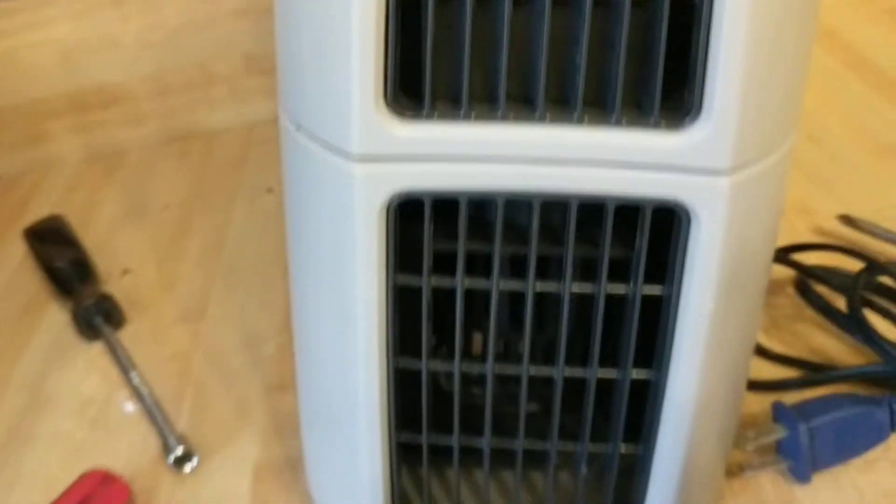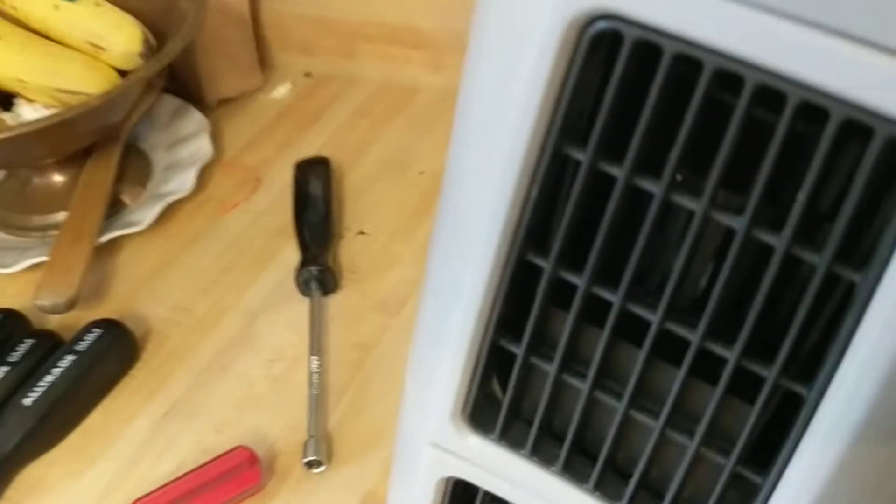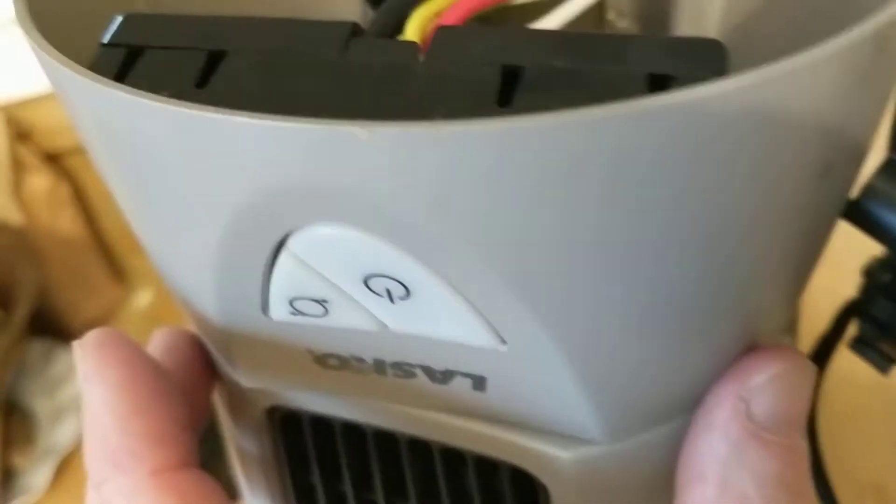I've changed the orientation and have the base on. You can see the flat parts are lined up, just as they were before I took it apart. Now I need to put on the two screws with washers that hold the base to the top. Since the oscillating base rotates a little, I recommend lining everything up before taking it apart — it makes reassembly a little easier.